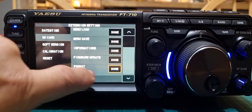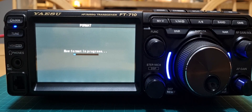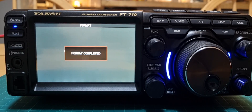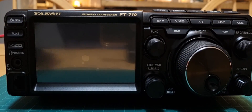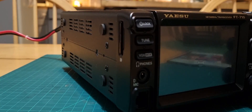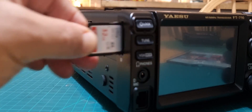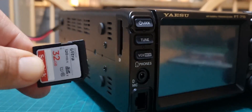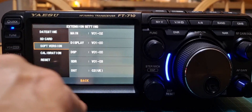Just click yes — it effectively takes you to the Extension Setting menu. Scroll down to the bottom or you could use a mouse and just click Format SD card. Let that run and it gets the card ready for you. Then you're going to take it out and plug it into your laptop or computer. Format complete — and it always makes sense to turn the radio off before removing the SD card. Just push it gently and take it out.